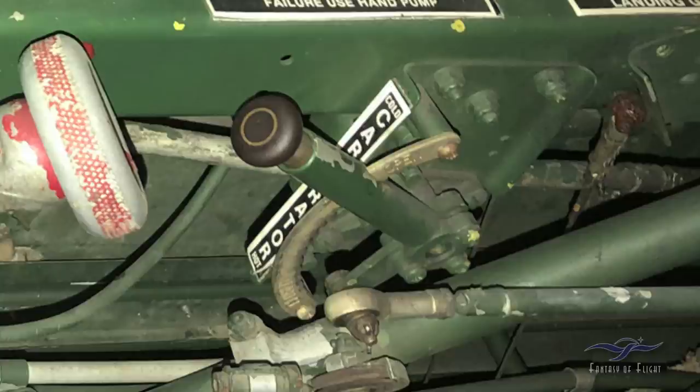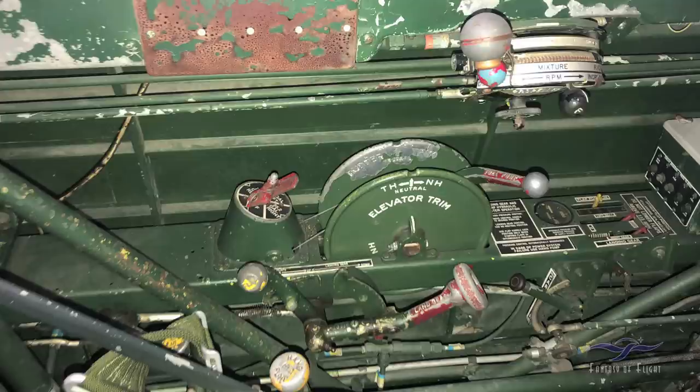Up here is the carburetor air — we're pretty much always flying around with carburetor heat cold and off. If you ever got into icing conditions, maybe flying through clouds, or if the engine started running a little rough in high-moisture conditions where you might pick up carburetor ice, you'd push that handle in, out of the detent, and adjust it to set the carburetor temperature a little warmer to burn or melt the ice out.